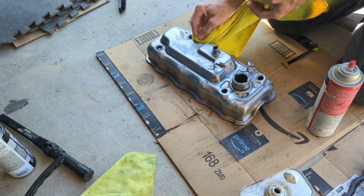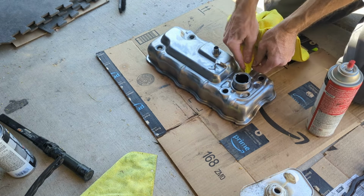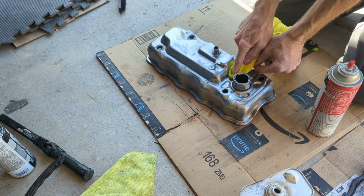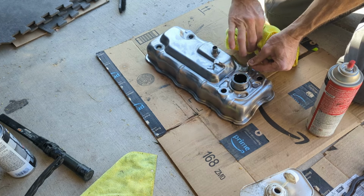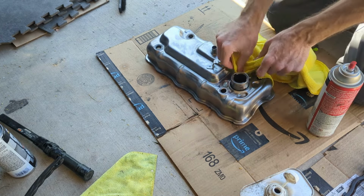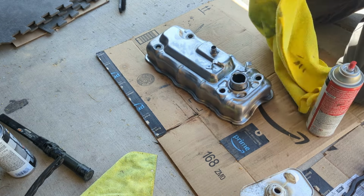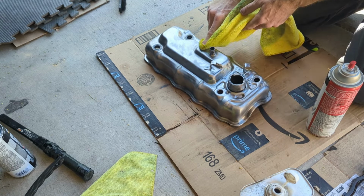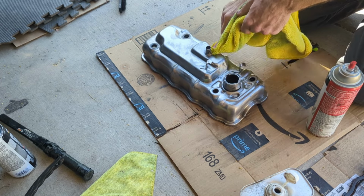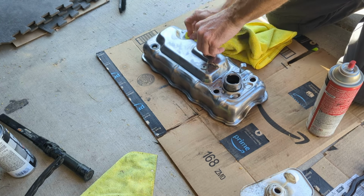That's why a lot of times you'll see, on certain paints anyway, I'll say you got to do additional coats either within the first hour or you got to wait 48 hours, which I have never waited that long. But I'm just going off what I was reading. And the reason for that is because if you do it within the first hour, then the different layers are off-gassing relatively at the same stage, so they can work together and do that.